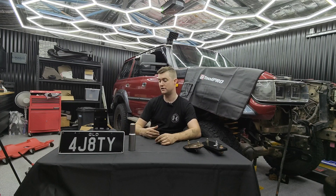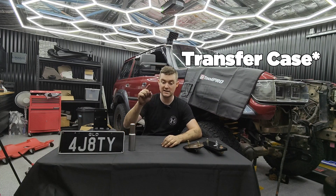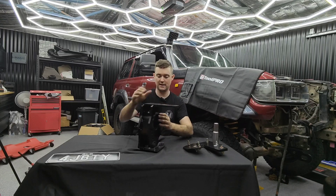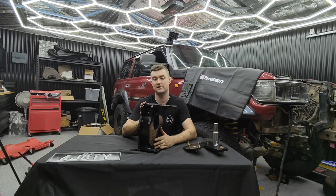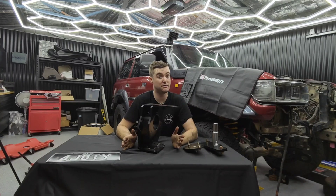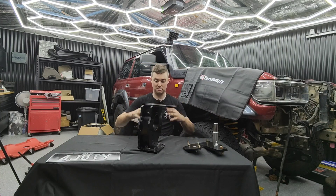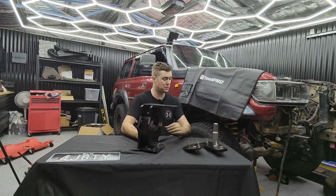Once you've got your A340 automatic transmission, what gets bolted onto the back of it? We will be using the Land Cruiser transfer case - it's a full time four wheel drive transmission that gets bolted to the back of the automatic gearbox. This is where Michael's kit really does come into play. He has designed this spacer which goes from the Isuzu gearbox and on the other side is the Land Cruiser transfer case. There's about eight bolts in it, and the top four bolt to the cross member on the transmission which bolts it all into the car. Still no welding involved - it is all just putting bolts together. This is a very, very cool bit of kit - Michael, you've done a fantastic job. It's all engineered and built and it's absolutely bomb proof, the steel weighs an absolute ton.